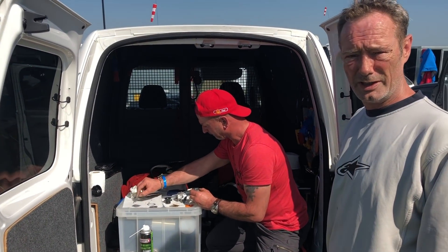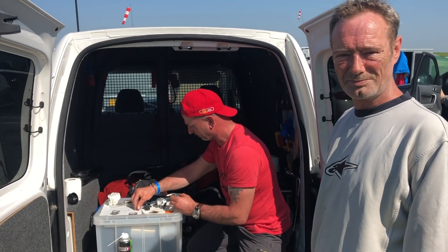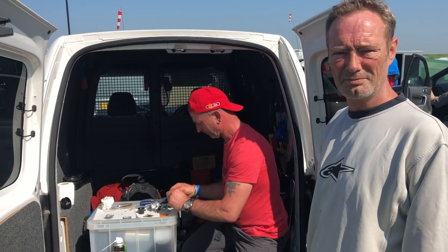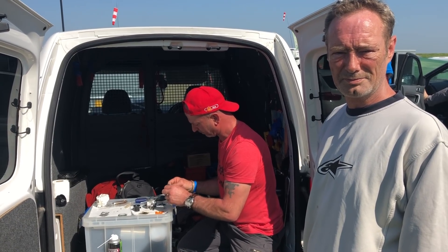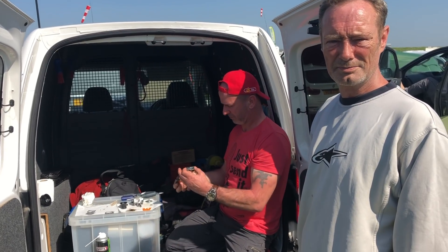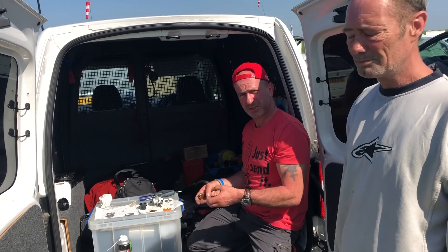I've had the machine a year now and flying with no confidence. I had the same on my motor for a long time until I decided to look at the carb, and ever since I've done that it runs really well. It runs rich and drinks a lot of fuel and I need to address that, but it runs really well. What temperature is it running? 135 to 150 max — still running far too rich.